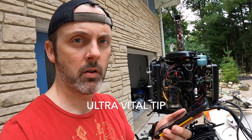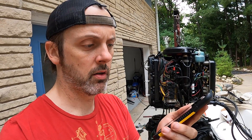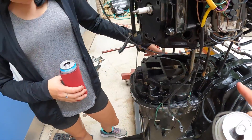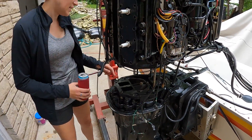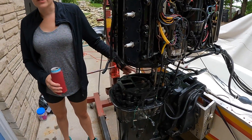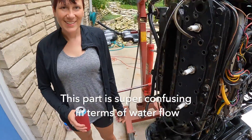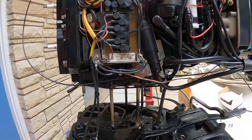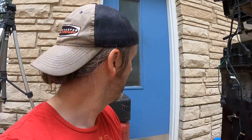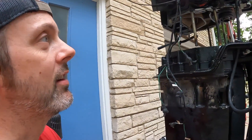We have lift off! At this point in the process, it's really important that you do this — can you bring me a beer? You can see that I definitely had some corrosion on this longer bolt. This is why the powerhead was not coming off. I used a combination of heat, leverage, and then I think the magic thing at the end of the day was the impact hammer — just took that up to the air compressor, started wailing on the end of these studs, and away she goes. Now we're going to look for the blockages.